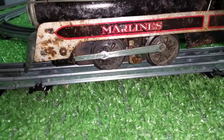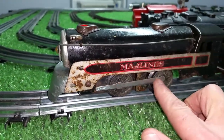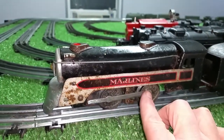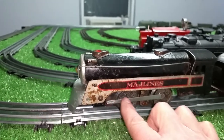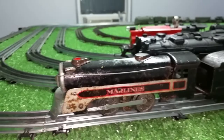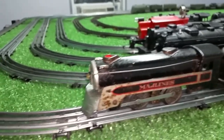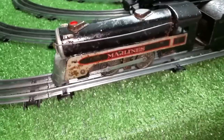I scraped the push rods with a single-edge razor blade, and I'll take an emery board and just give them a couple of quick wipes. That'll take all the little scratch marks off and give it a nice matte finish. But all in all, with a bit of touch-up on the surrounding paint, you can actually improve the looks of these things quite dramatically.